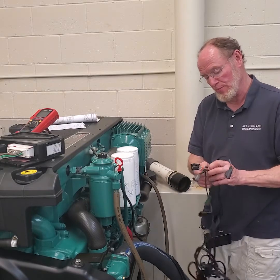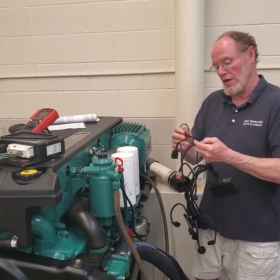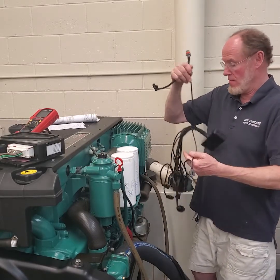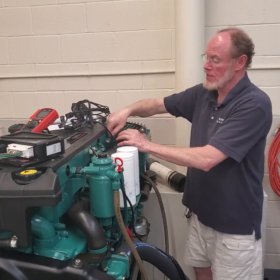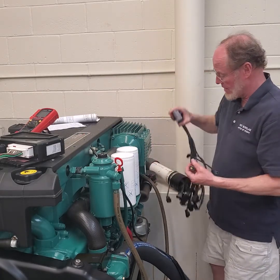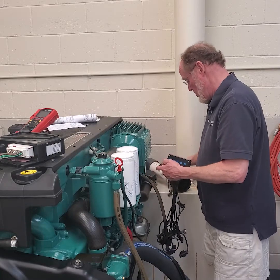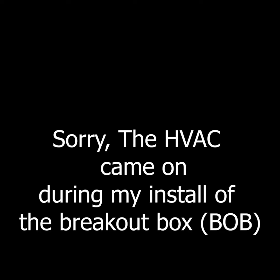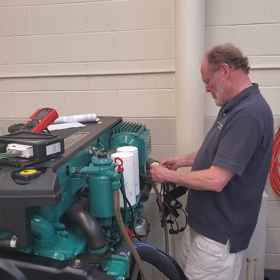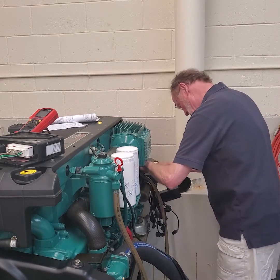You have your high pressure pump — it needs the two-wire connection. I have unplugged the m-prop, and I'm going to take this and plug into it. What I need to do is break into the harness — I'm going to take one end and plug that into the harness, and the other end I'm going to break into the pigtail. It's behind the DC-to-DC converter, so it's a little tight.